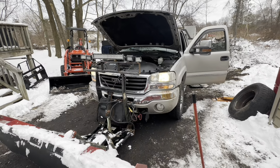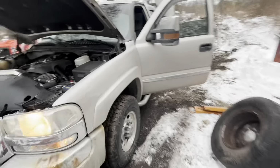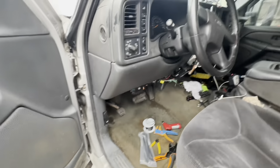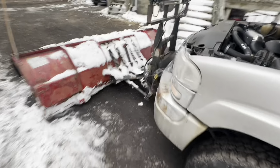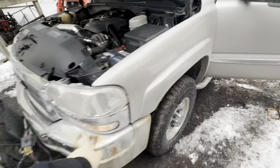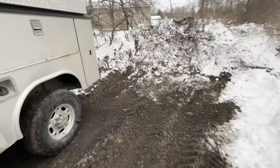Okay, so the switches ran. So keys on, low beams are on. I'm just doing this quick, so I just threw the switch here for now. And there's already grounds ran in there for all my stuff. So key's still on. Lights are still on. But the switch is killed. So you still have marker lights. And I should still have taillights.